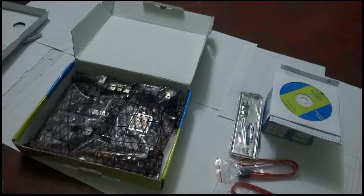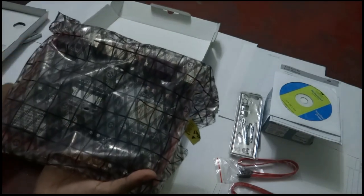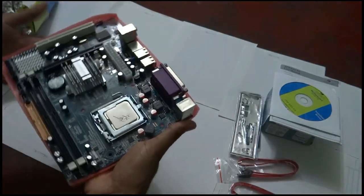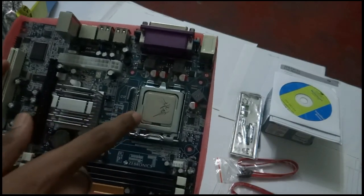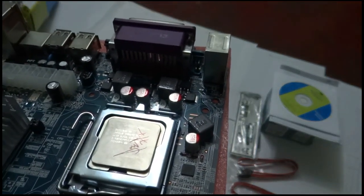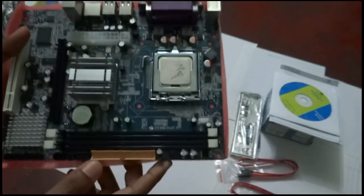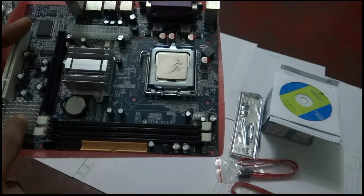This is the main motherboard, which is covered by black plastic anti-static wrap. Here is the Core 2 Duo processor running at 2.40GHz clock speed — I believe it is a second-generation processor. I'm not sure exactly which one. There is also an IDE port for old PATA hard drives, two DDR3 slots, a CMOS battery, and the G41 chipset.